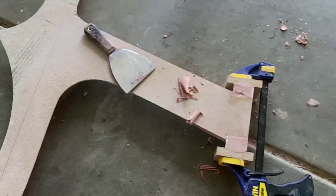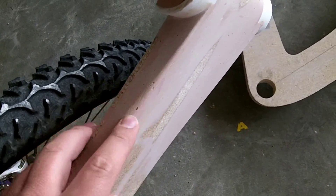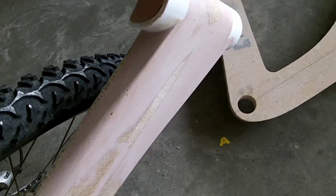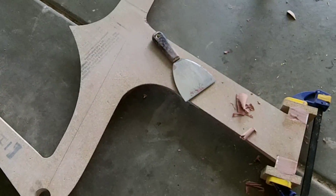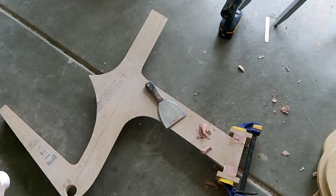What I'll do next is fill in all the little holes that I've got with some professional glazing putty, which is kind of like Bondo but thinner. Then I'll fasten the plug to a board so we can create a female mold off of it.